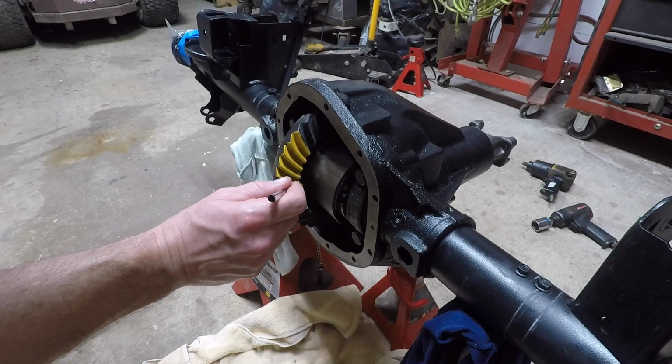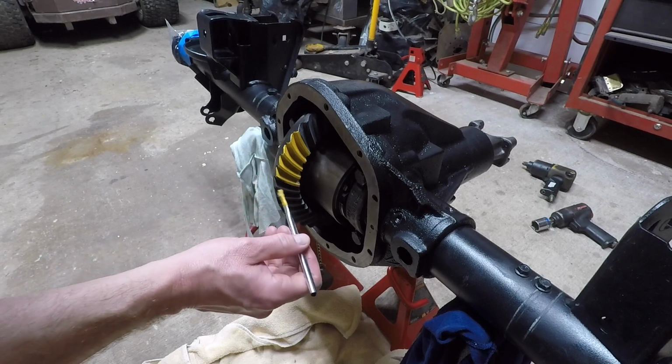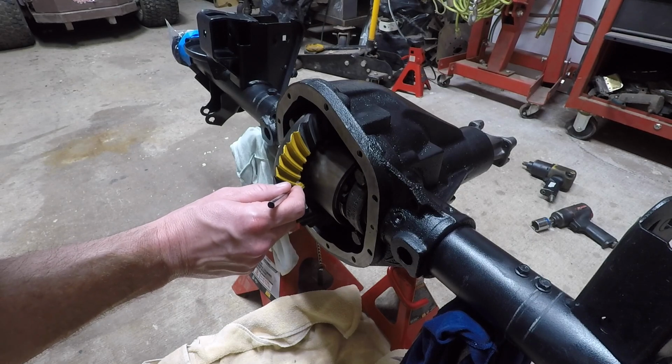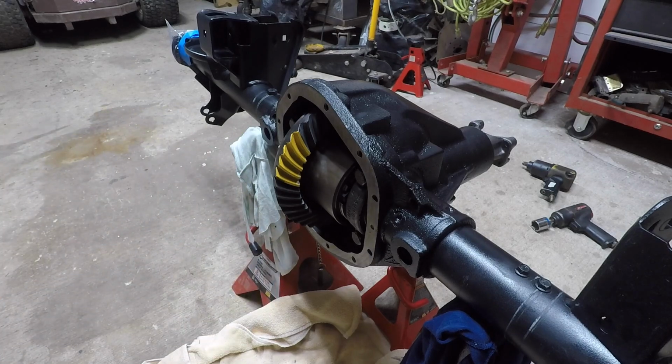However it comes out of the tube, it's going to be extremely thick, and just paint that stuff on. Because if you're new like me and this is your first re-gear, you're going to get to a point where you're going to have to take brake cleaner and clean off that gear, because it's almost going to give you a false pattern because this marking compound has been so diluted. So put this stuff on directly out of the tube and don't bother with diluting it.